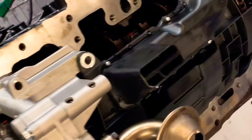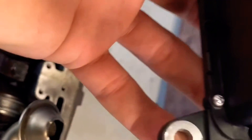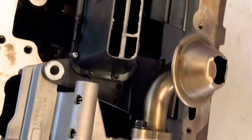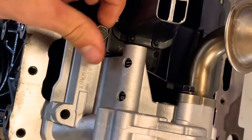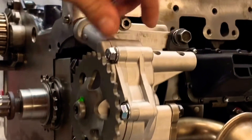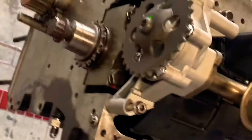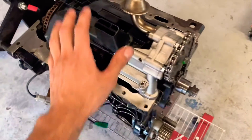This little piece here also needs to be drilled a bit — not much. I was using a larger bolt so I had to drill that a bit more. This is pretty much how it looks. The bolt screws right up and now we got two 10-millimeter bolts. That's pretty much it — that's the pump installed with the valley pan. I will be installing the chain and the tensioner in a few minutes. Here is everything pretty much already on — I got the pump on there.